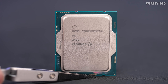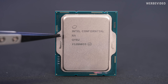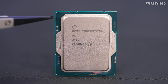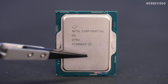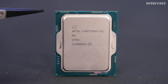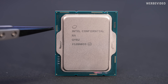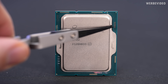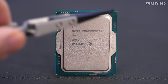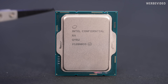Also keeping in mind that this CPU is 99% chance soldered, which means you need more force and more movement to be able to delid it. You're not only loosening the glue underneath but also the indium which is sitting underneath. Aside from that we have a lot of testing and probing points — top left, bottom right — that's the QR code for scanning the CPU serial number, and also on top we have a lot more probing points than there used to be.